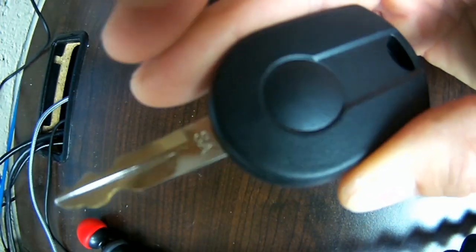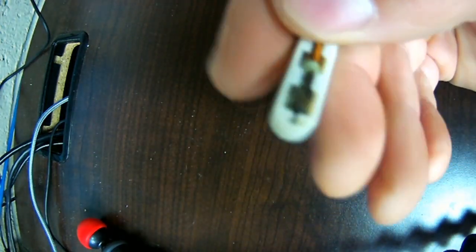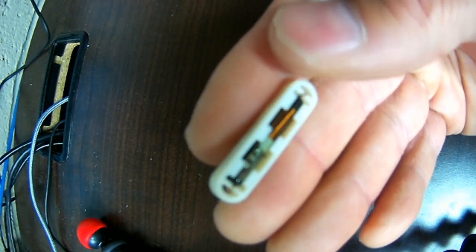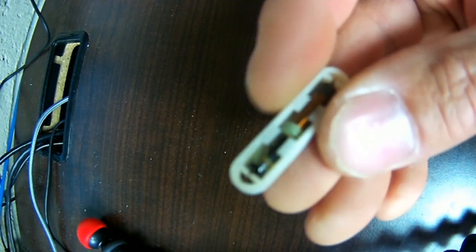When we're talking about PATS — if you're not familiar with it — PATS stands for passive anti-theft system. That means we have a transponder in a key. This is what's inside the key and has basically the passcode, if you will, to allow the vehicle to start. So the vehicle is looking for this signal in the key to allow it to start.